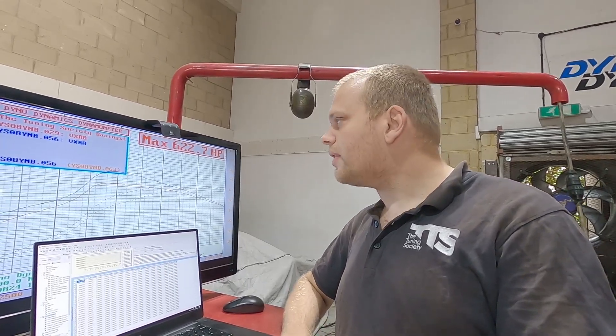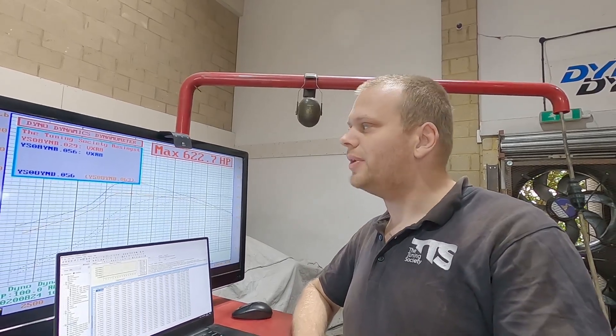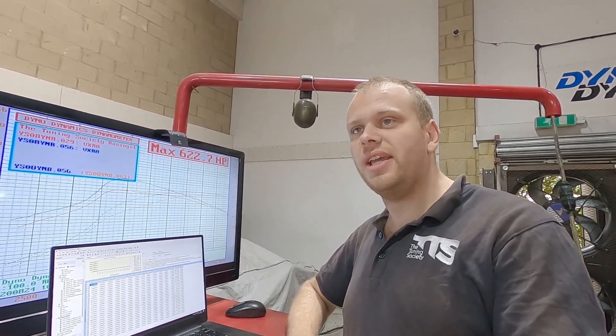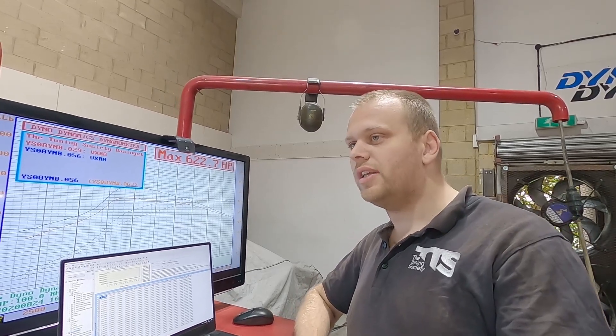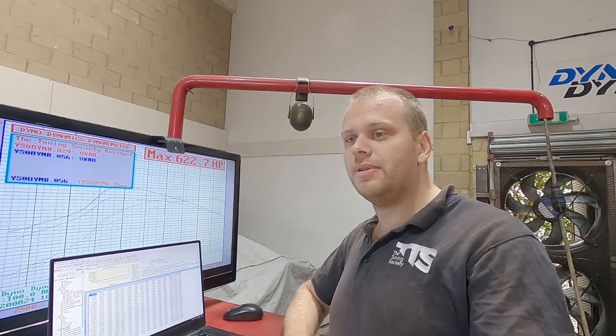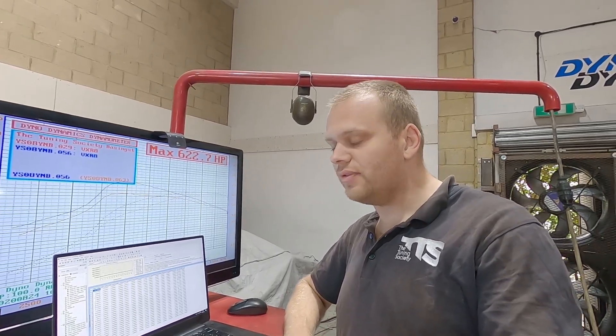The car fuels properly, boosts properly — it's good to go. I hope to do another one soon, maybe with some bigger turbos. A pair of GT28s on there would be really interesting. From my research, LS engines can take quite a bit of boost in stock form — 10 to 12 psi quite happily — so I'd like to see one with bigger turbos. It's been a good experience. And if anyone else wants GM LS tuning in the UK using factory ECUs, we can cater for you — turbos, superchargers, whether it's an LS1, 2, 3, whatever. Get in touch and we can probably help you out.